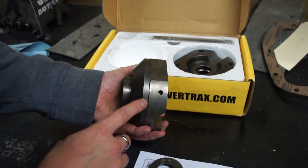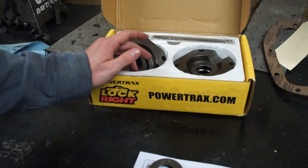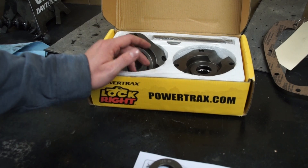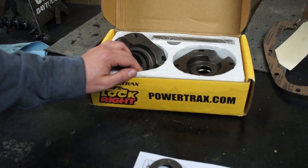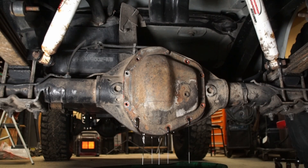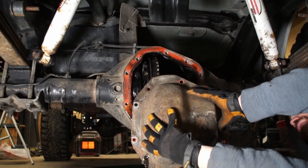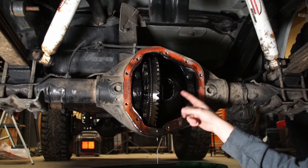This type of locker just replaces your side gears and spider gears in your differential. You don't even have to pull the ring or pinion out, so you don't have to reset your differential. This makes them a lot quicker to install. They're way cheaper than a selectable locker, and they work just as good. You might get some popping when you turn, but I can put up with that for half or a quarter of the price of one of those selectable lockers. If you ever see a YouTuber plug a $2,000 part where a $300 part will do just as good of a job, just ask yourself — would they still be plugging that if they didn't get it for free from their sponsor? For this build, I'm going to keep it realistic and go with a lunchbox locker. My god, that's a big differential. One ton axles have huge parts — that is twice the size as what I'm used to seeing.